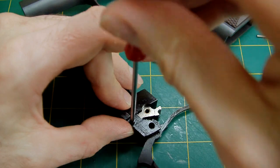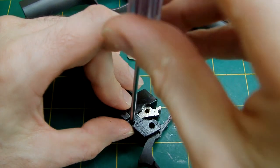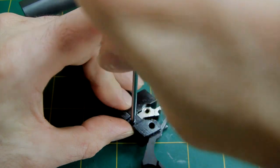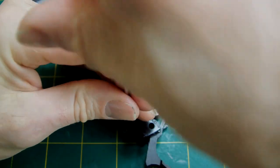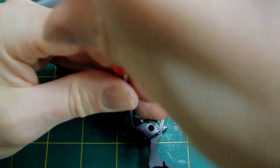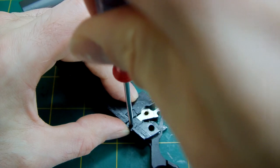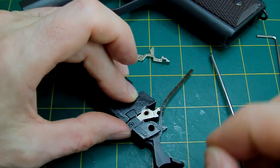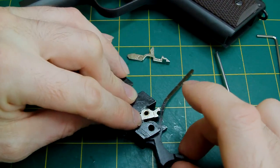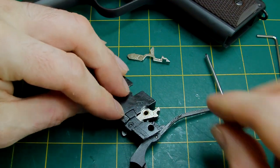So be careful. Again, like I said earlier, you want to back up with the screw — do it as if you're undoing it, and there's a click. Now you can start to screw the screw back into position, because otherwise you'll cross-thread it. That's got nice and tight. So you back off a little bit — not a lot, just a little bit. With threadlock, if you were going to do this, you'd put threadlock on the screw and it's not going to move anyway. Check the hammer that it's not too loose and that it's working and moving around. Always check.